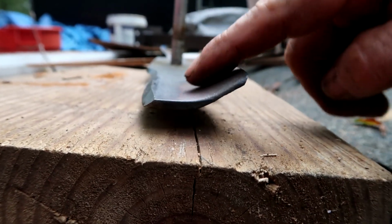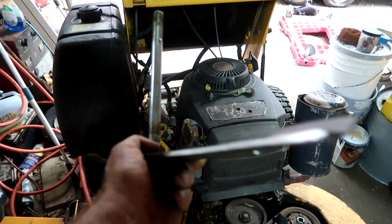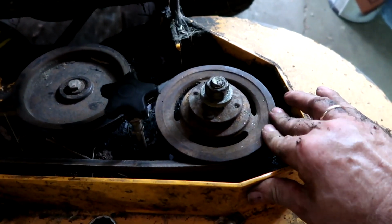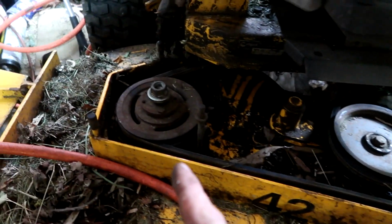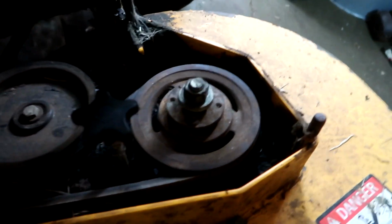We want to face the fin up into the deck. This is actually spinning around quickly and making a vacuum and lifting the grass into the cut. Sharp blades make your grass look really nice. The ends aren't torn, they're nicely trimmed, and you don't get a yellowing on the end. But aside from sharp blades, you want greased bearings and balanced blades.